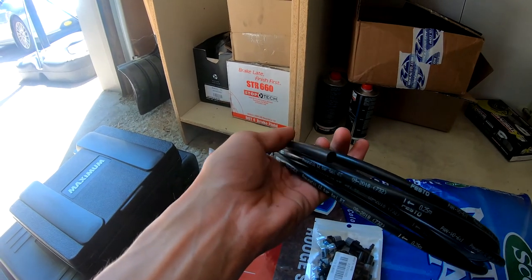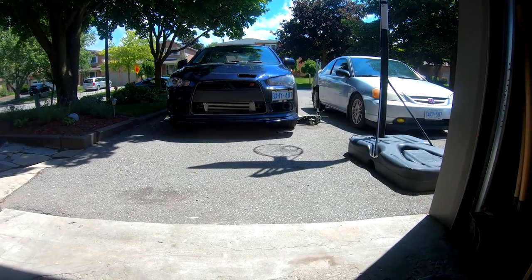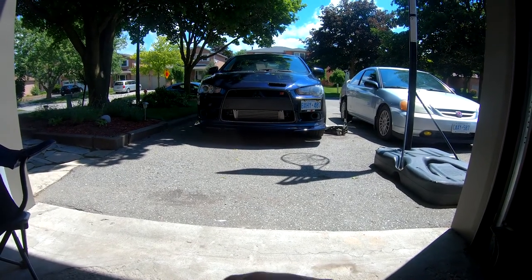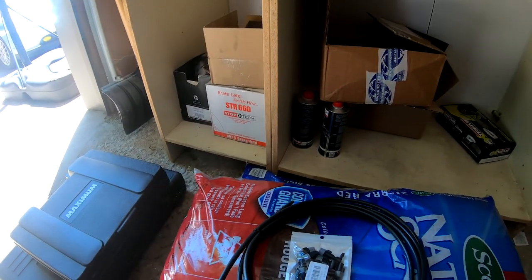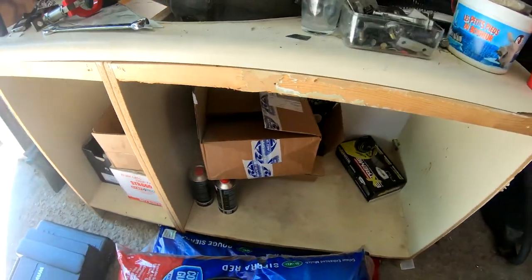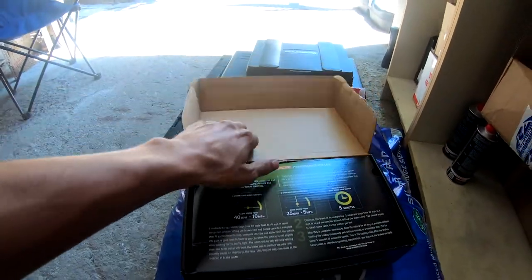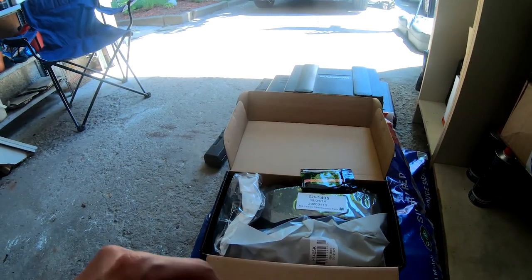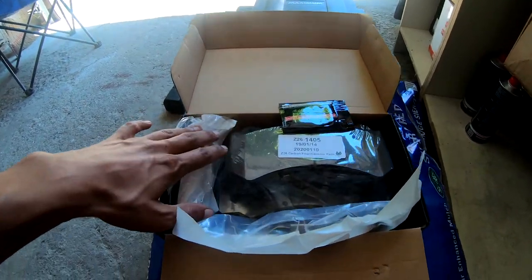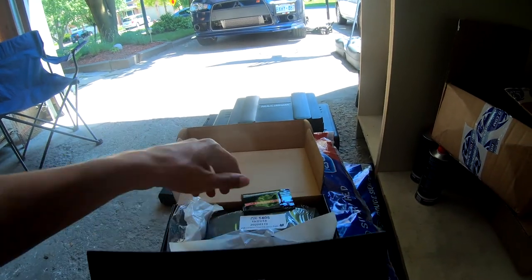Here's some insulated line. I'm hoping that the washer fluid reservoir is what I'm going to tee off of. It uses a quarter inch or six mil line to make this all work. Another thing is new brake pads — I bought new front brake pads. I don't like the ones that came with the brakes, so these are for the Cadillac CTS-V 2006 model.